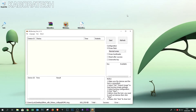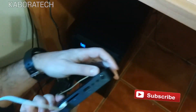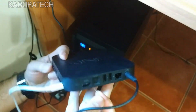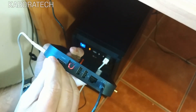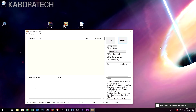Select 'Erase Flash', connect your Minix with power and the OTG cable, and you have to press the power button and the recovery button at the same time for a few seconds. Windows 10 will then recognize the device and the USB Burning Tool will connect to it.